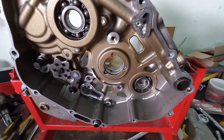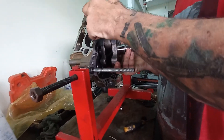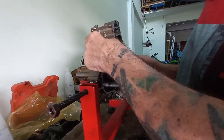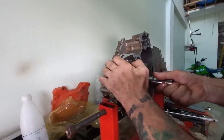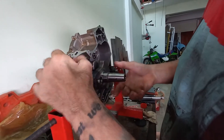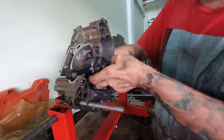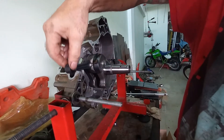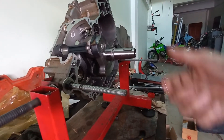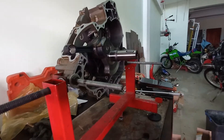Let's offer the crank up. Honda don't supply any clearances that you can measure, so although that seems like a large amount of clearance to me, I'm going by what they say in the book and they say use the blue bearing - so that's what I've done: new crankshaft, blue bearing. What I can do now is horse the other casing on.